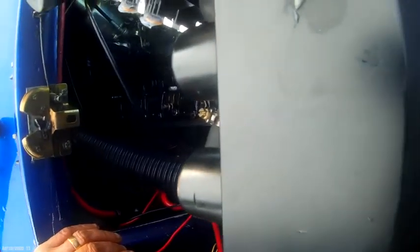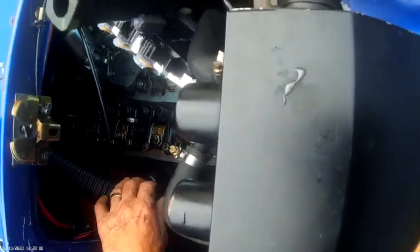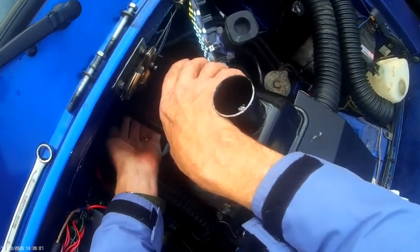Now, you have to make sure that little petrol guard needs to be kept out of the way. And just over there, I don't know if you can see it, there's a fuel line, and it runs right across the top. Now you've got to get it over there. It is tricky. I'm not going to deny it is very tricky. So you've got to be really careful. You do not want the gasket to lose position.